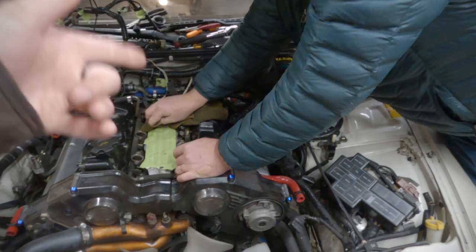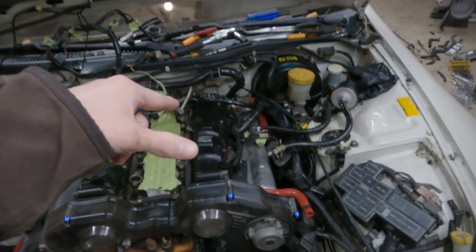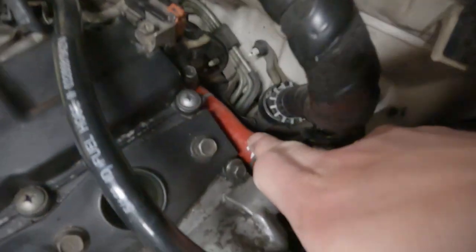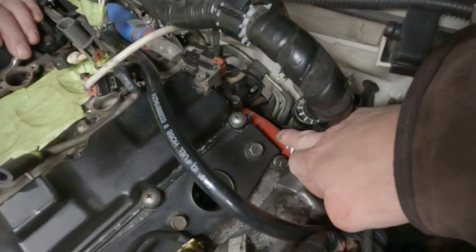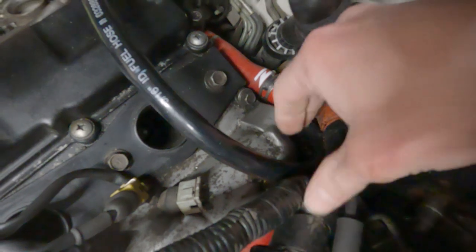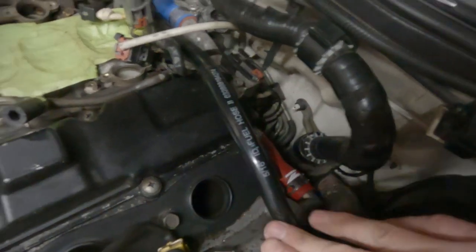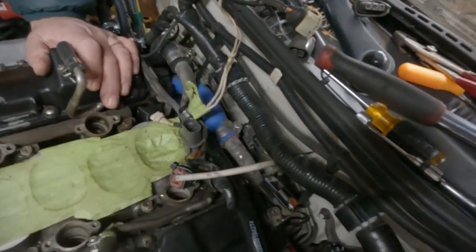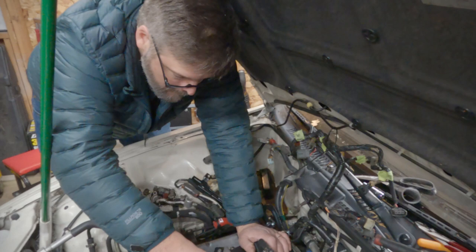Last weekend, we spent the whole weekend working on these hoses back here. This PCV hose was really difficult — we showed you guys cutting that off. After that, we decided to loop this coolant line, which originally goes under the intake manifold and we don't need that, so we looped it around kind of back into this sort of Christmas tree of coolant lines that rests on the back of this motor. It took a long time and was extremely difficult.